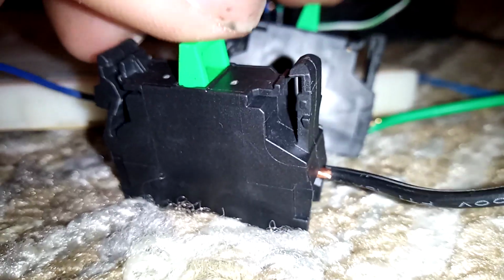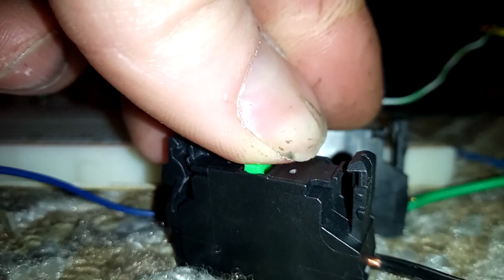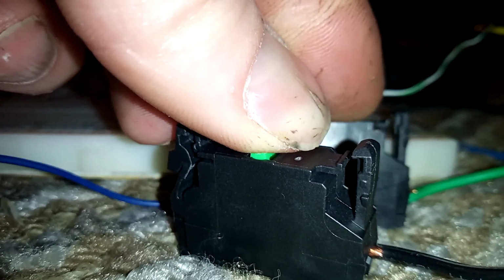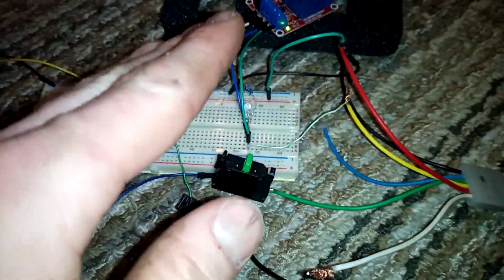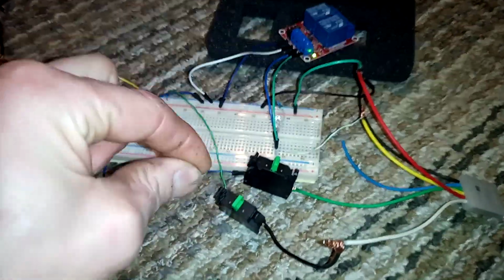I'm going to try to do this here. Let's see. So hold the 2 buttons down. And then plug your positive wire in. And you'll see as soon as I did that, the light came on. You can let go as soon as the light comes on. There is a light built into this if you don't have one on a breadboard. We are now in programming mode. Anytime you start it up with green and white touching ground, you're in programming mode.